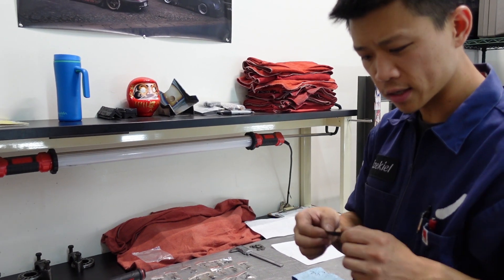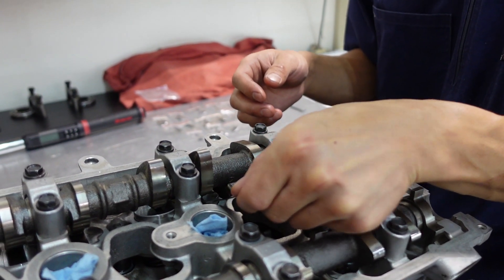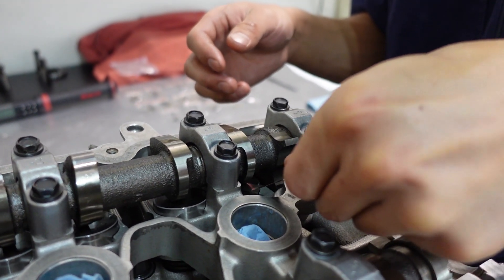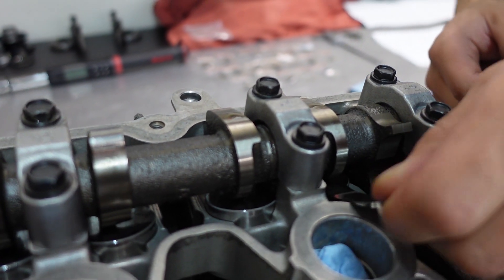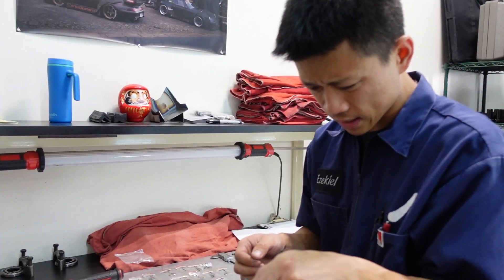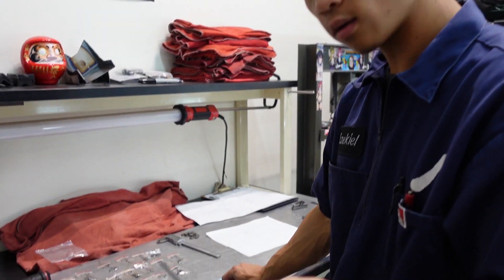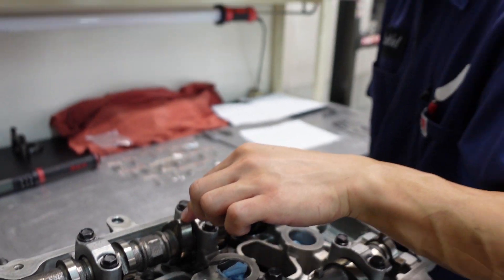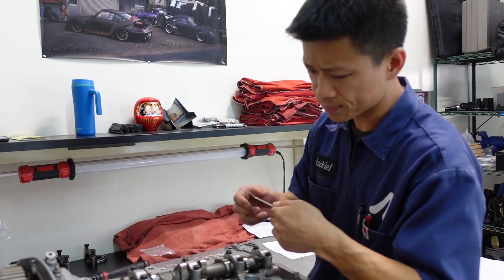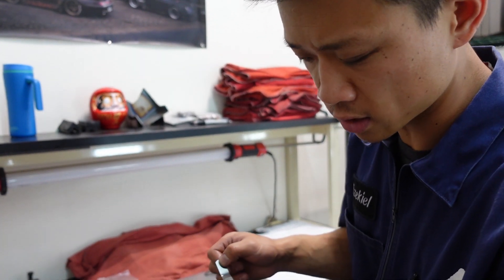So 0.22 is about the middle of my spec for intake. I can feel that's like a hair tight, but that's good. Wow, that's tight still — 0.229. Let's double check the tight ones. 0.20 barely goes in — I think I'm going to have to loosen that one up. Here's a 0.254 — yeah, this is still within our spec, so we're okay. My 0.254 does not go in on that one. This is probably a 0.22, which means this one's within spec — actually 0.22 is right in the middle of our spec, so this one's actually perfect. We're going to leave this guy.